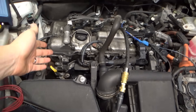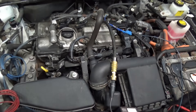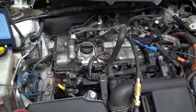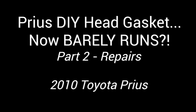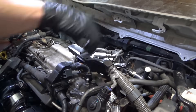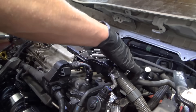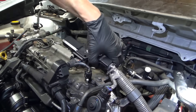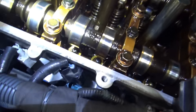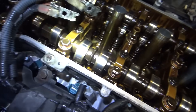Customer authorized removing the valve cover and inspecting why the intake valves are not opening. Let's get it done — peel back the onion. The valve cover only took a few minutes to loosen up. With the wiring harness out of the way it popped right up. We've got two rollers just hanging out in here — they're not on the intake valves for cylinder number three. Mystery solved.